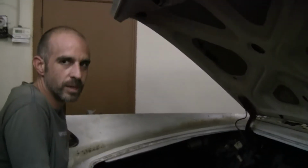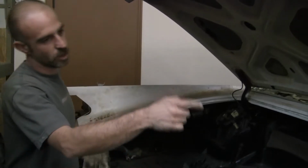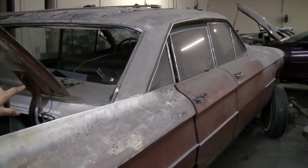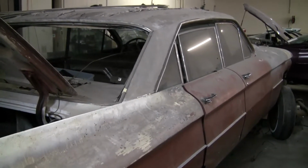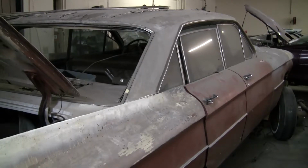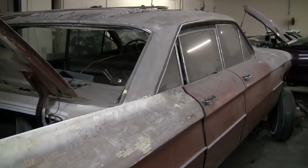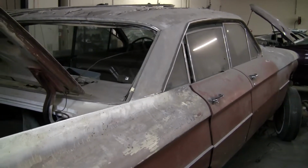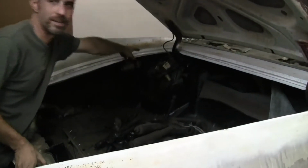Made this car, the car that you were driven in, not that you drive, because in order to open the door, the one wing, the way it's offset, look over here, you can see the way it overlaps at the door. So the one wing, the rear quarter, had to come back before the door could be opened. The air suspension and the ignition would not activate if the back doors were open, because again, there's people in the back, so if they're open. So that was an early safety feature.